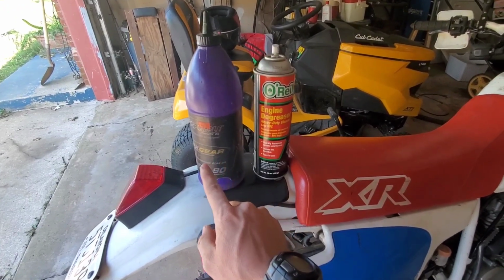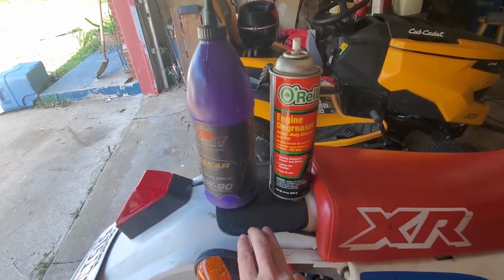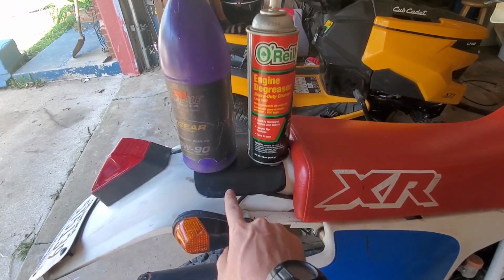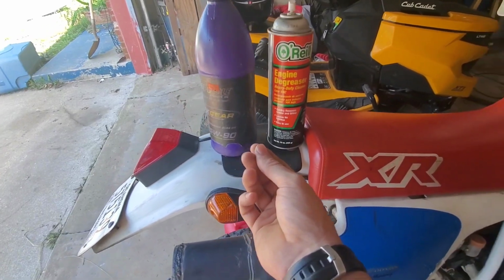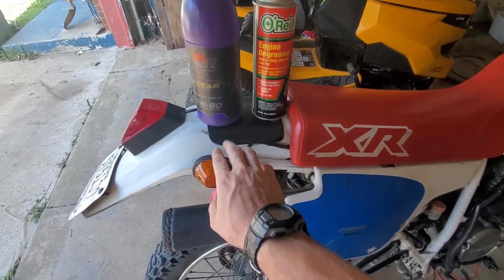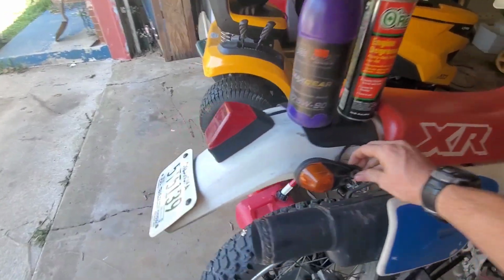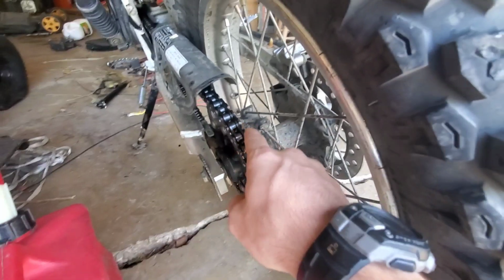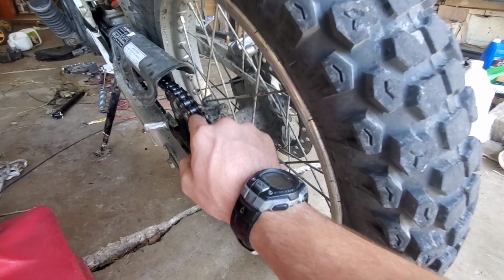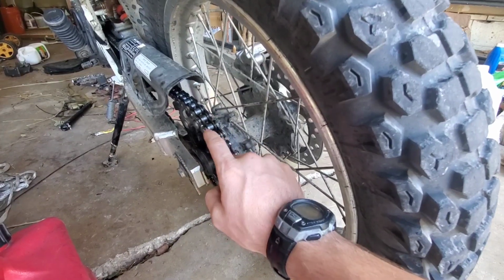And then also you need that to melt the grease, and the type of grease you use is moly grease, that 3% moly that Harbor Freight sells, because that moly acts kind of like a graphite lubricant, and it does a good job of preventing that significant amount of pressure that these rollers experience whenever you gun it on your chain. These have tons of pressure on them, and that moly is made for heavy equipment where you experience a ton of pressure.